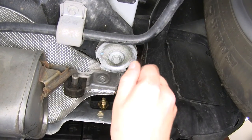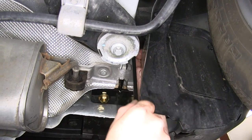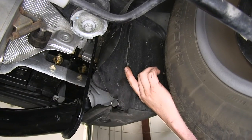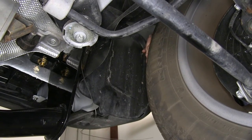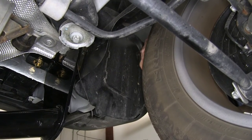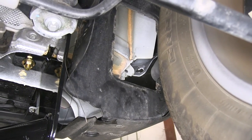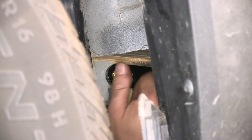Now get your side bolts pulled through. Once you've got those pulled through, take your pull wire off of them, making sure not to drop the nut back inside the frame. There is a small access door that you can remove the screws from to give yourself a bit more room to get your arm in there and see what you're doing — there's one on each side. Take out the plastic Phillips-head screw at the top, then just turn it sideways to get your arm in. Repeat that on the other side as well.